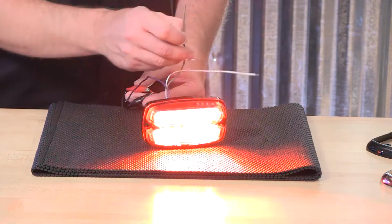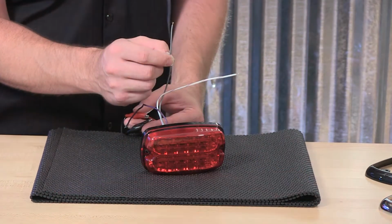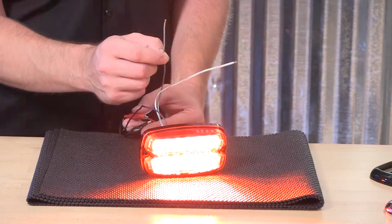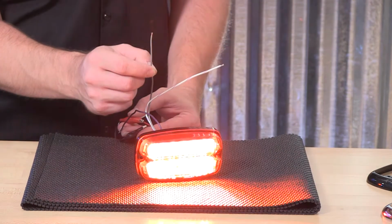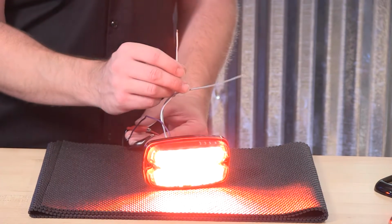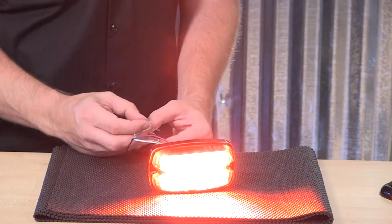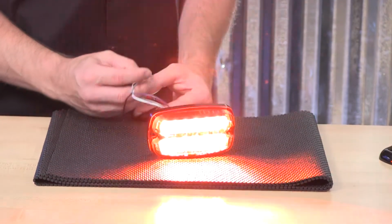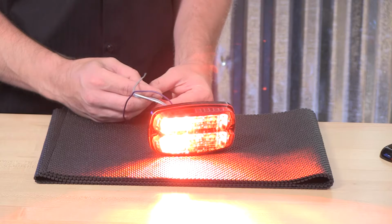The gray wire allows for synchronization across the board with the M series family. So you can have M4s talk to each other, or if you'd like to mix them up, an M4 can talk to an M7, and so on. For flash pattern adjustment, scan lock wire, white with the violet tracing. Momentarily apply it to a positive 12 volts, and it adjusts the flash pattern.